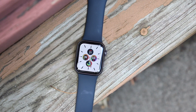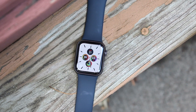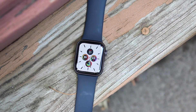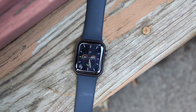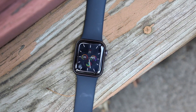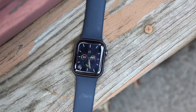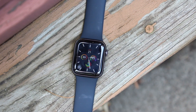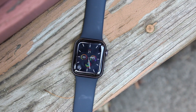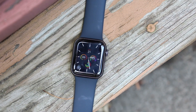If none of these things work and you still can't get it connected, I'd recommend unpairing your watch from your iPhone and then re-pairing them. You don't have to do it immediately, but go into the Watch app, delete the watch from your phone, then re-pair it and restore it to the same version of software it was on. That should fix the issues. If not, restarting your watch and restarting your phone can also help.